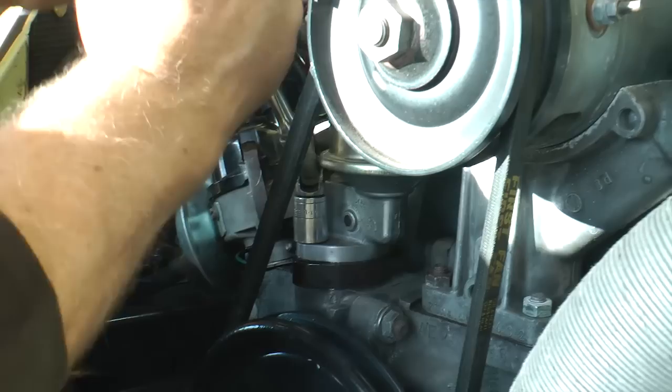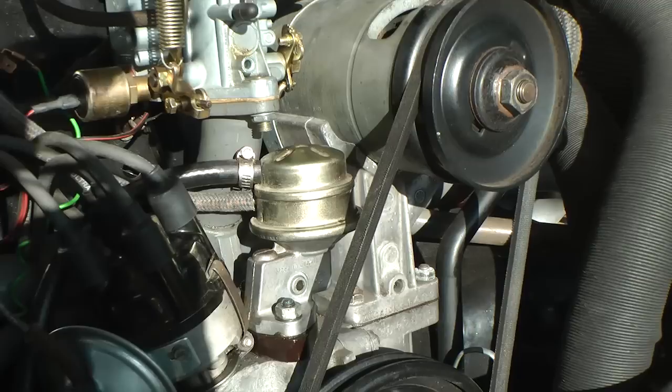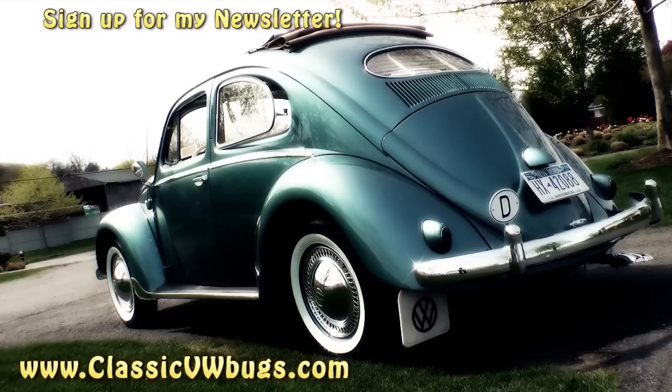Place your fuel pump down and get your 13 millimeter nuts and start tightening it down. You might need a universal end like my dad has here on his ratchet so you can bend around and get to the one in the back. Many times when your engine gets hot, that stem that sticks through the block will swell, basically hold the rod, and put your car into starvation mode where it's just not getting any fuel.